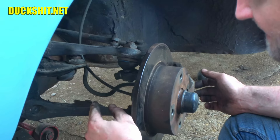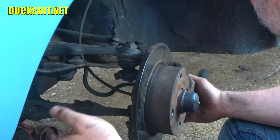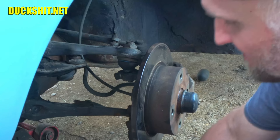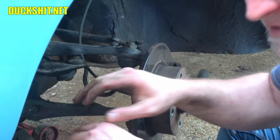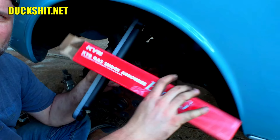I haven't put the rubber bump stops back on because lowering the car means we're now much closer to the bottom of travel. The bump stop is a limiting bumper that gives a soft cushion before you bottom out. Since we're so much closer to bottoming out now, I don't think we should put them back in. We'll leave them out, get the car settled on the ground, and see. If needed, I might just cut them down a bit and shorten them up.